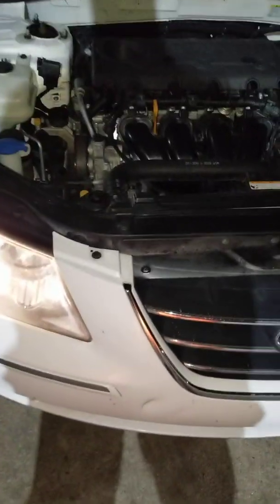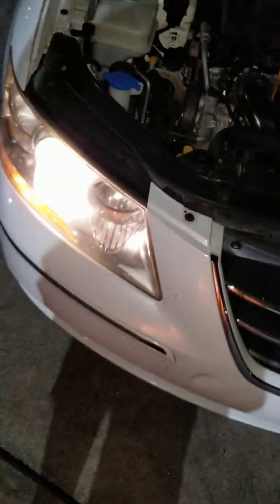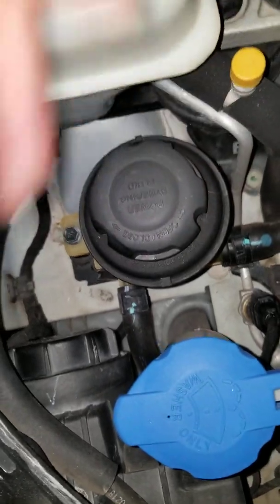And you are all good to go. Just so you can check and believe me, I'm going to turn the headlights on. There you go — both my headlights are on. That's the one I just changed. So if you have a 2010 Hyundai Sonata Limited and you see videos about taking out the whole headlight assembly, you don't have to do that. All you literally have to do is go in, take off the cover, twist it out, twist the new one back in, put the cover back on, and you are good to go.